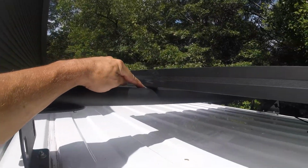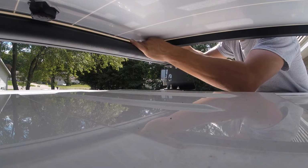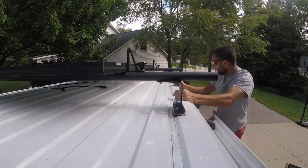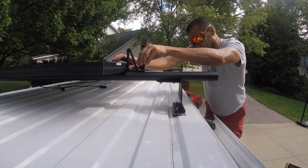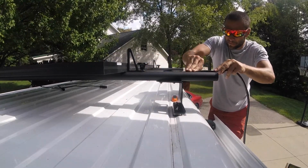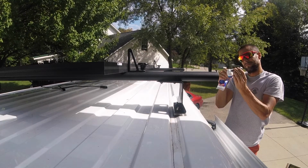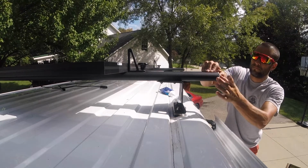I actually put a little bit of a cushion underneath each corner before I tightened it down, which is what I'm doing right now. I also installed a little extra protection to kind of clamp the solar panel together on either side so it doesn't move. I don't think it will move, but just in case. Then I added some weather stripping into the open gaps so that we don't get the wind noise or the whistle noise. And then I added the caps with a little bit of Loctite so they don't fall out onto the end of the roof rails.